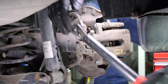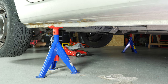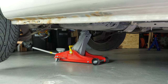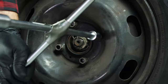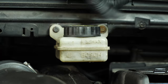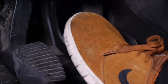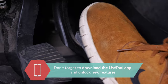You can now repeat the operation on the other side. Put the wheels back on your vehicle and lower it to the ground. Before starting your car, don't forget to screw the brake fluid cap back on. Before using your vehicle again, start your car and pump the brake pedal a few times to bring the brake pads together. Try to drive smoothly and avoid sudden braking for the first 50 km or so to avoid glazing the new pads.